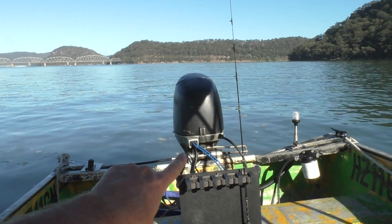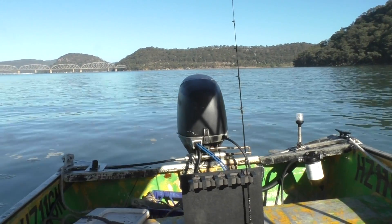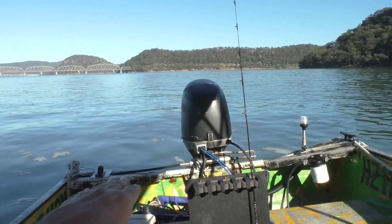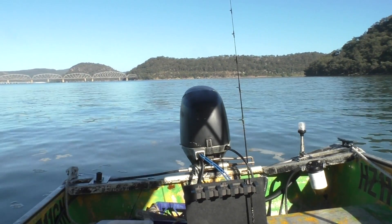So I've marked a line on the leg of the outboard, level with the transom bracket. With the boat sitting level in calm water, that should give me a reasonably accurate indication to measure against of how high up it is trimmed now.